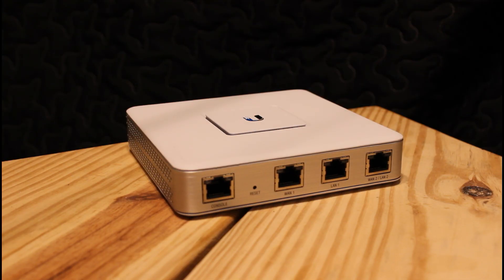The top LED, right around the UniFi logo, is similar to the UniFi access points if you're familiar with those. It has a couple of different colors — white and blue — and depending on the color, that indicates what state the device is in. Flashing white means it's booting up, solid white means it's booted but not adopted, and blue means normal operation — adopted to a controller.